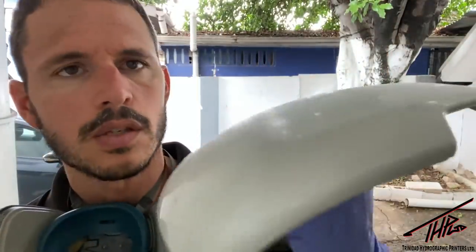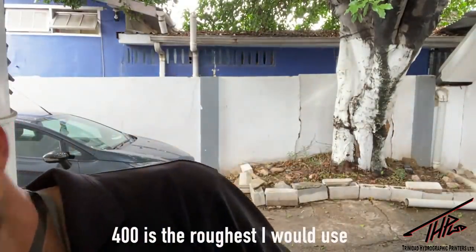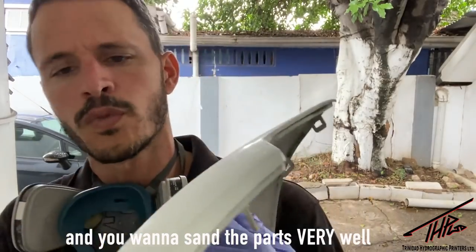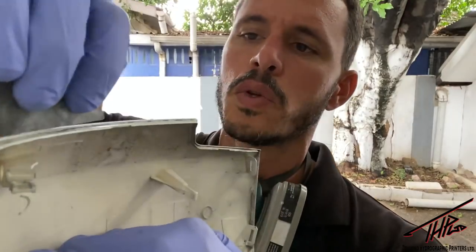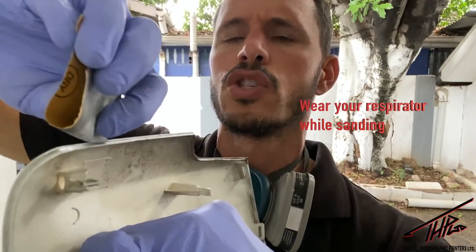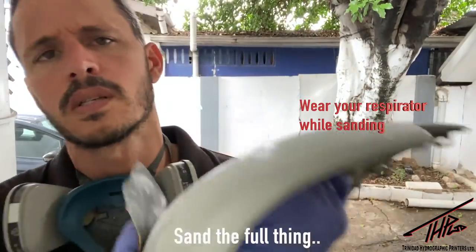The next step: I'm using 400 grit sandpaper because this is already painted and in good condition. 400 is the roughest I would use before laying my base coat. If it's any coarser, when I base coat it, even when I clear coat it, the scratches will reflect underneath. So you want to use 400 grit and sand the parts very well. Get into all the corners — you want to get it all up inside there because you don't want any flaking paint. Always sand your edges.